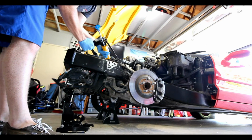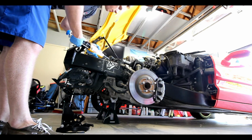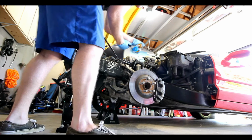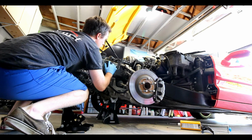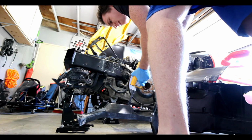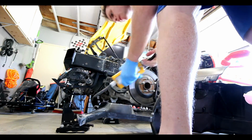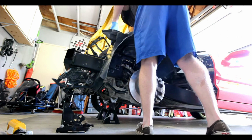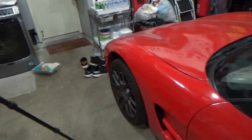So this, I had to grind the frame down to bare metal in the areas where it was being bonded on, and then I applied this and smoothed it over that entire bare metal area, because this is the corrosion inhibitor. This is what's going to prevent rusting of the steel frame, because this has to bond directly to bare metal. It can't be bonded to painted metal. And then this then bonded to the SMC formed inner fender with my 3D printed inner fender spacers to help set the right panel gap here with the hood and the fender and the door and everything like that. So I use that when bonding a SMC or composite part to the metal frame on the car.